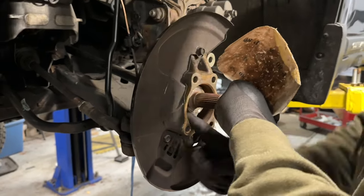If you want to make life easier for the next person who does this wheel bearing job, you could go ahead and apply some anti-seize on the hub surface. We're going to install the rotor, and then to hold the rotor in place, I like to grab just one of the lug nuts and hand-tighten it on there just to hold it in its spot.